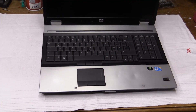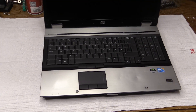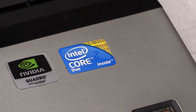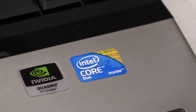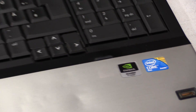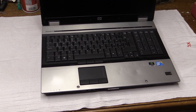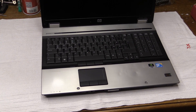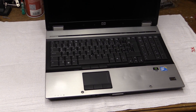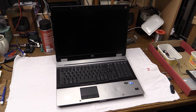All the other hardware is not all that up-to-date. It has four gigabytes of RAM, and while the sticker says it has a Core 2 Duo processor, the previous owner upgraded it to a Core 2 Quad. I'm not sure that was done properly because the ventilator fan is always spinning at a rather high speed but it doesn't bring out any hot air, so I'm assuming the processor-to-heatsink contact is not the best. That's basically the point of this video.